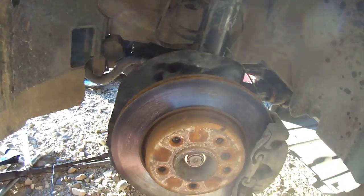I'm just going to put my splash guard back on and I'll be done. Just taking the car for a test drive — finally got it all back together and the differential is changed. The only thing I've got to do is when I take the CV axle back for the core charge, I'm going to see how much a ball joint is. I damaged the boot pulling the lower control arm off, so it's just a matter of time before I have to change the ball joint. Looks like you can get a control arm with ball joint from the United States for about $110 plus $25 shipping. Right now the car seems to be working fine.